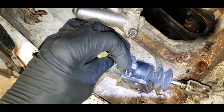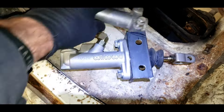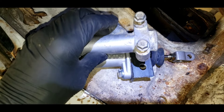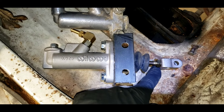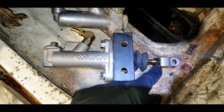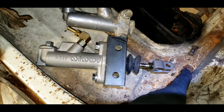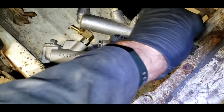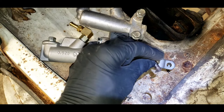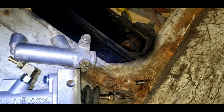You have to make a bracket. I take a one-by-one angle iron and drill it in the same holes so that you can mount it to the side — that's one thing you have to do. The other is you've got to cut the rod down. This is the piston rod that actuates the cylinder. The factory one is too long — it sticks out an extra two inches and you've got to cut about an inch off. You can reuse the clevis arrangement: here's your clevis pin and there's your clevis yoke. That yoke will go right onto the factory part of the pedal — that's important.